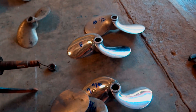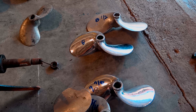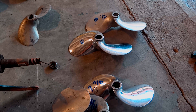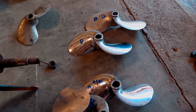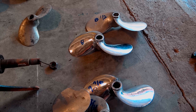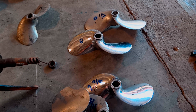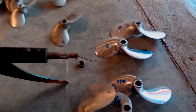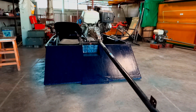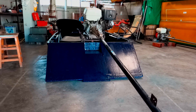This is about props and all the different things you can do. With high performance props, grinding a prop to match the power curve, and surface propping — a lot of people don't do it. A lot of people just put the prop in the water and go. Maybe their engine doesn't reach the highest RPM, maybe they don't go as fast as they could, but maybe they don't care — and that's fine. But if you're into tweaking an engine and getting it to work as best as it can, you put the right propeller on for your conditions and grind it down if it's lugging. The most important thing I stress in all these videos is balance — and this includes balance on surface propping as well. The propeller you use the most is going to give you the best surface propping results.